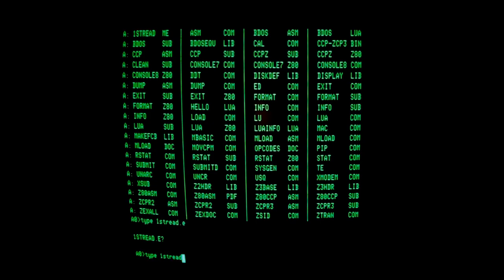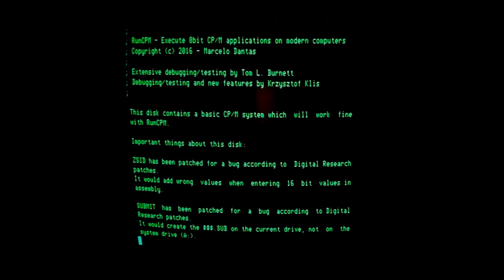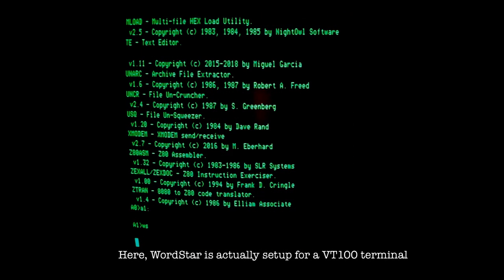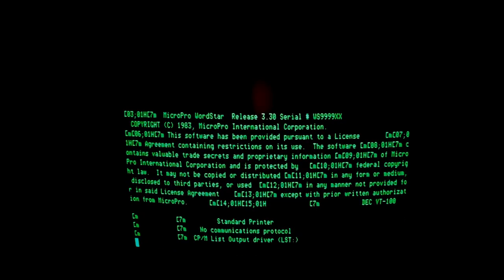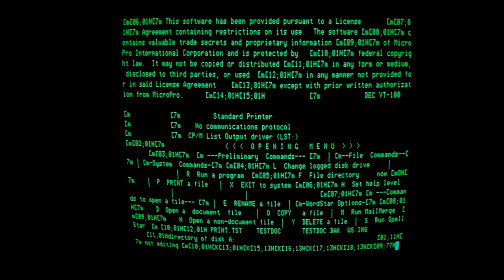What's more, BobTerm emulates the VT52 terminal, and despite setting the terminal type within WordStar to Heathkit H19, screen output is significantly garbled. Ideally, what's needed is a VT100 compatible terminal that supports the XEP at 9600 baud. That combination will produce a really usable system. If you have any suggestions, once again, please leave them in the comments below.